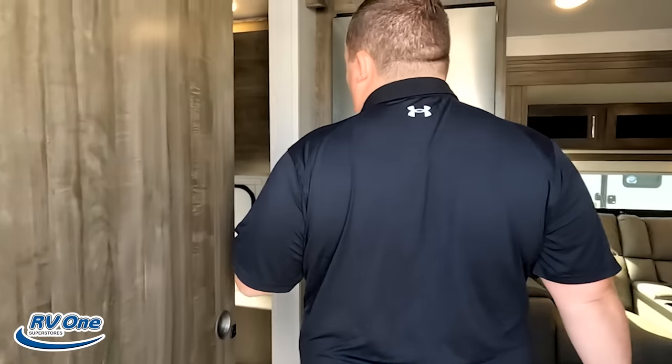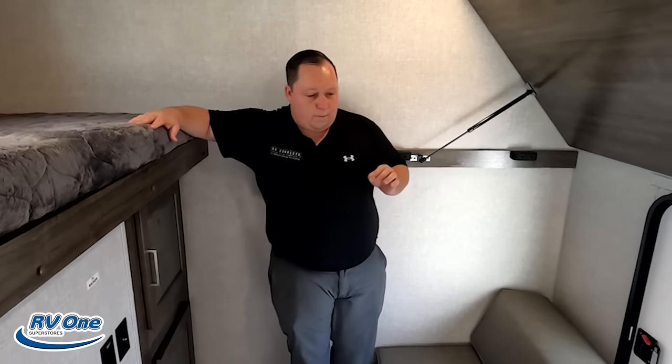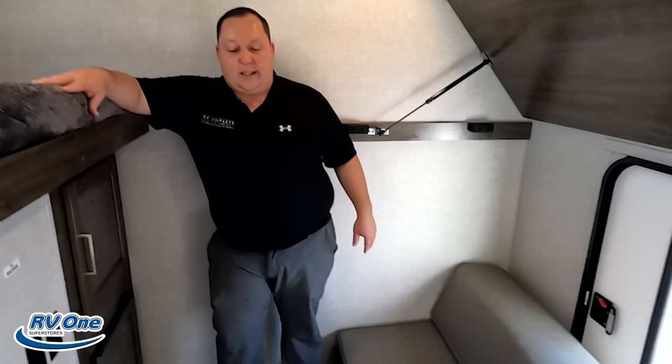Number three combined is also the heavy tongue weight — at 1,038 pounds you'll need weight distribution bars. We recommend a Reese-style setup. So front-heavy tongue weight and the small rear bunk room are combo number three for dislikes. That's three things we don't like about this trailer.